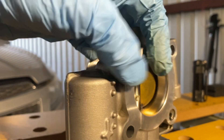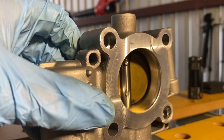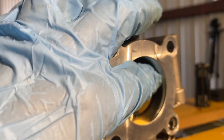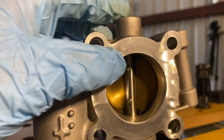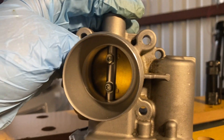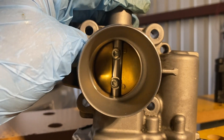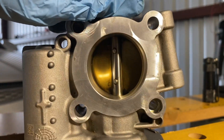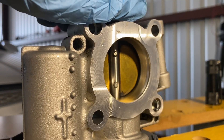On the other side, on the outlet side, once it does manage to make it out, it's actually hitting another air dam right here. There's a lot of bulk here. So I think you only really have an effective 20% of the surface area that's actually being utilized for airflow. 80% drag. No bueno. So I think we can fix this.